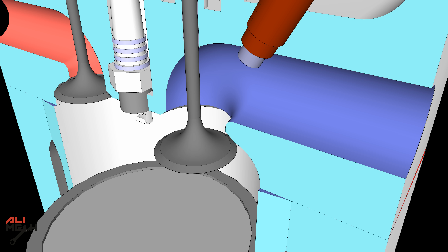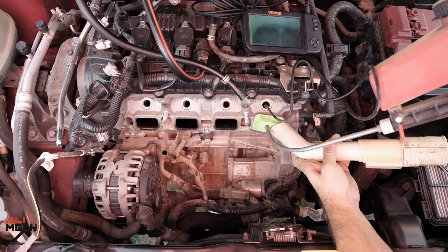That's why it's called direct fuel injected. With non-direct fuel injector cars, it will clean it because the fuel injector is spraying fuel on the valves and washing it out every time it sprays fuel, but it won't have contact with the back of the valve. So it's not going to be like what I will show you in today's video.